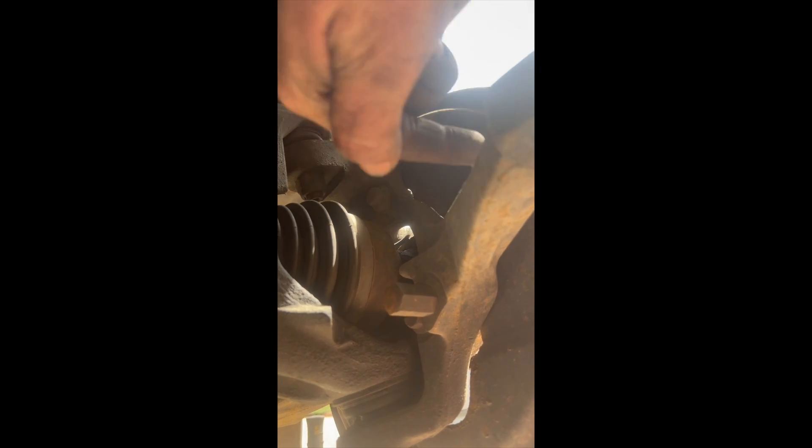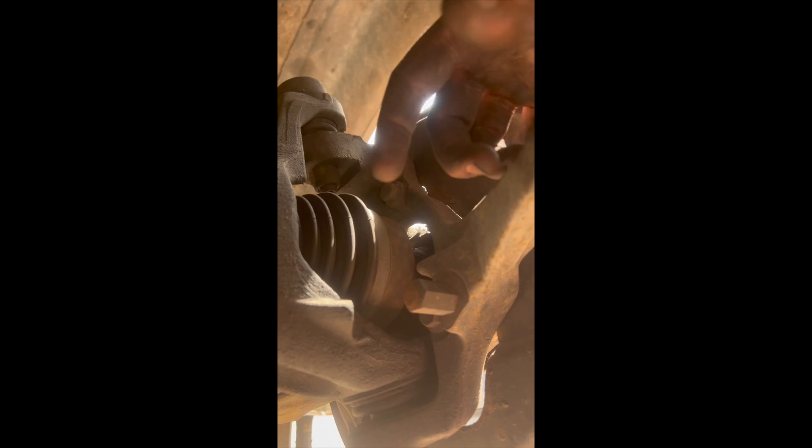Now in the back, you're going to have four 15-millimeter bolts — one here, one on the other side, and the two up top are kind of close together. The best way to do it, because if you try to get up in here you can get a swivel or something but it makes it a pain with leverage — unlock your steering wheel and just pull it one way or the other, whichever bolt you're loosening. I like to pull it to the left-hand side. Once you turn it, it makes it a lot easier to access. Even with a swivel and half-inch, I could still probably get to that, but the swivel gives me some wiggle room.